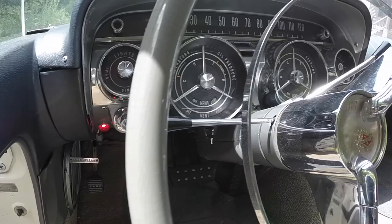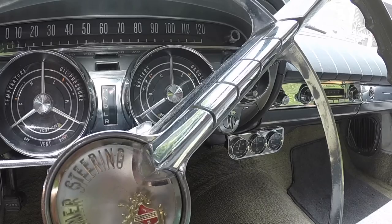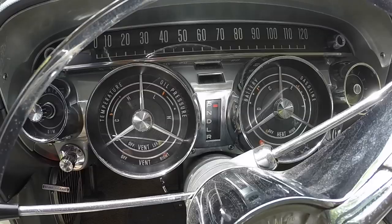You don't even have the sending unit hooked up to it. I think the only gauge that works is probably the battery gauge. The fuel gauge does not work — it's probably the sending unit in the tank. But the odometer works, so I've just been using the trip meter odometer method.